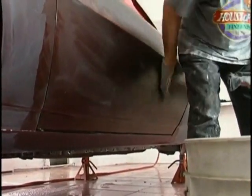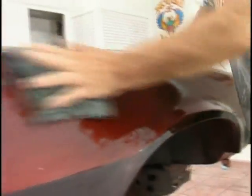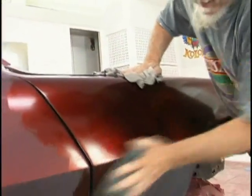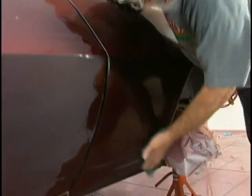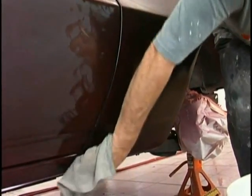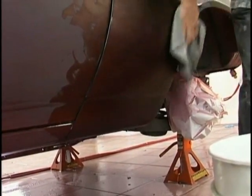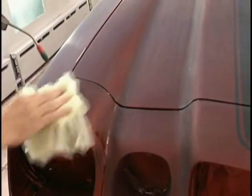But one of the best ways, of course, is to jamb the doors with the base before you go ahead and paint the outside. Then you can easily come in and do the touch-up with the candy with a little intensifier and get those easily covered. I always do that before I do the color sanding. Then any overspray that gets on the outside gets sanded off.